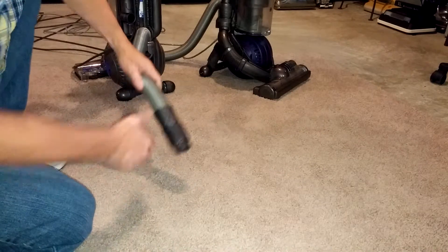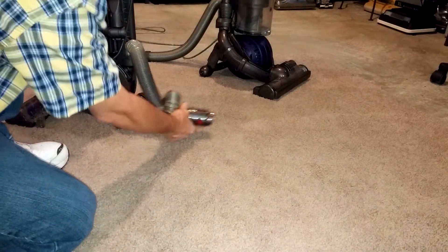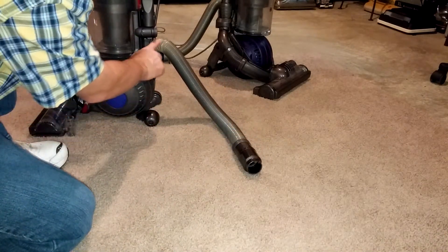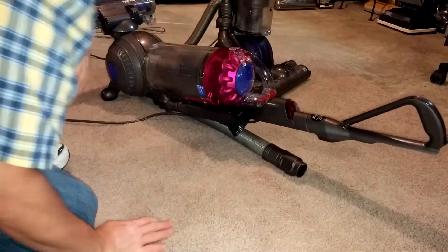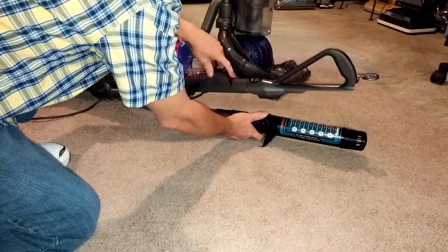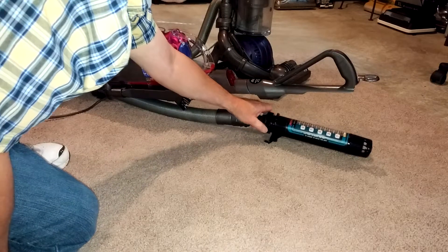Also, when you're measuring with a hose, you don't want to have a bend in it. The last thing you want is to have something all knotted up with all kinds of weird bends and 90-degree angles, because the amount of airflow will be reduced. When I do my tests, especially with my anemometer, I don't measure vacuums with a bend in the hose. I'll simply lay the vacuum down — that keeps the hose pretty straight — then put the Baird meter on and measure it there. Only having one bend in it won't make that much difference, and we're at a three, so it's not bad.